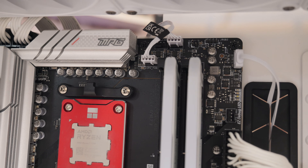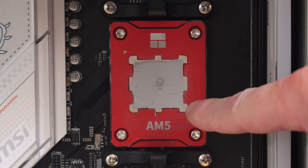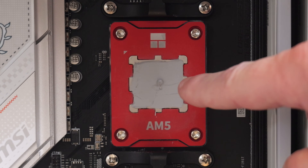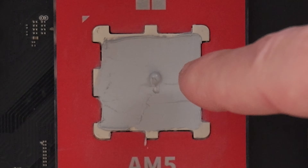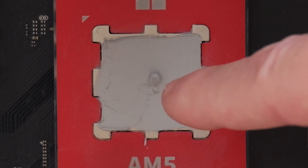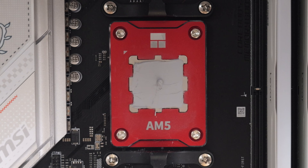Next, we're going to go ahead and install the pump. Now we've applied our thermal paste — this is always one of those things people get triggered by one way or the other, but there isn't really a wrong or right way of doing this. I've come to the conclusion that using the cake spread method works well — spreading it across pretty much all of the surface of the IHS. And to please those that say you'll get air bubbles, there's also a small dollop in the middle. The pressure of the CPU cooler is going to press on that, and if there are any microscopic gaps in the paste, that should be enough to spread through with the pressure and heat cycling, giving pretty good coverage.